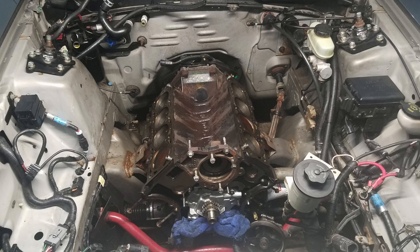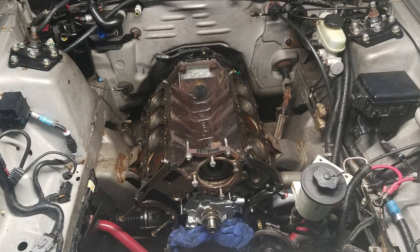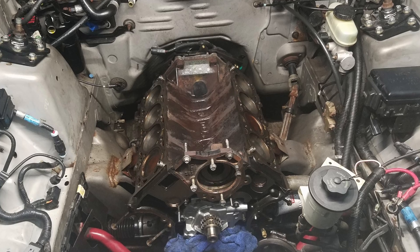I need to cut in and say something here. When cylinder number one is at top dead center, the only other cylinder that is even possible to bend valves with would be cylinder number six. I know this because I did head gaskets on this particular car. So watch out for cylinder number one and cylinder number six.